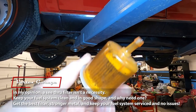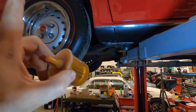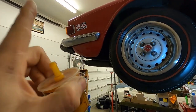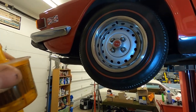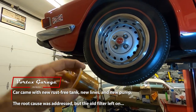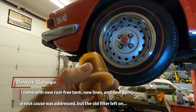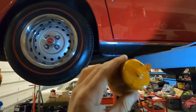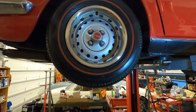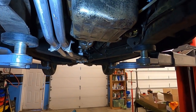You'd look at this rust and think there's got to be something else going on — what are all these contaminants in the filter? Well, when I look at the vehicle, the fuel tank has been replaced with an alloy aluminum fuel tank. So my guess is somebody replaced the fuel tank very recently and didn't replace this filter, because with a brand new fuel tank it's nice and clean inside — there's no way you'd have this contamination otherwise. My guess is it's from the old rusty tank. They swapped it out and didn't replace the filter. So we're going to be in good shape with the new filter. If you're changing your filter and see something like that, you should ask yourself why.